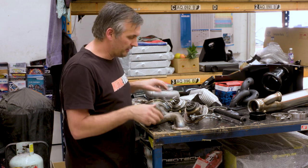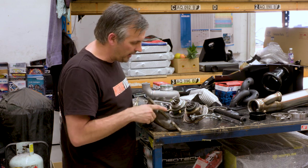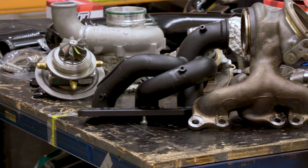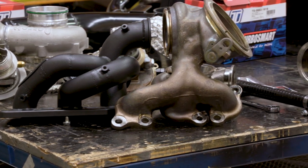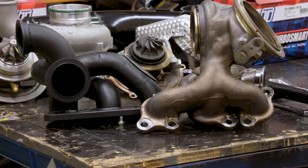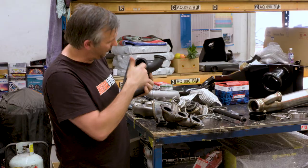If you want to compare the exhaust manifold, this is integrated, and you can see the three join very quickly. So the exhaust gas flow has a very sharp turn coming out of number one and number three, joins into number two, gets quite turbulent, and it's very short to get to quite a thin section as it goes into the turbocharger. We grab the Six Boost one, has a full-size merge collector, a well-designed merge collector inside, so you can see the flow will be a lot better.